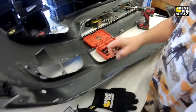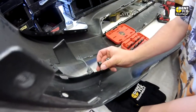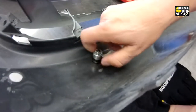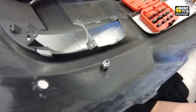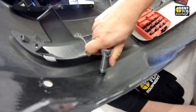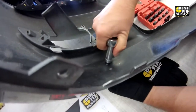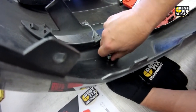At this point we will place the cutter through, and then we will take our last plate with the 19mm showing down, place that facing down, and tighten down on it. Making sure we have a good hand tight going. Then we take a 13mm ratcheting wrench and we start tightening it together. The pieces are pulling themselves together and literally cutting right through. I believe it has made its way through — it has become very easy.